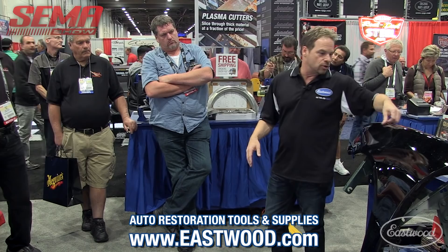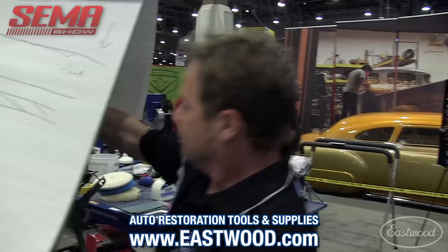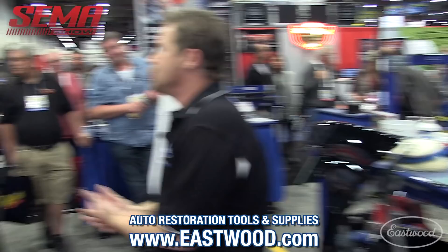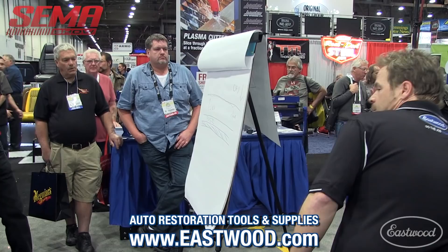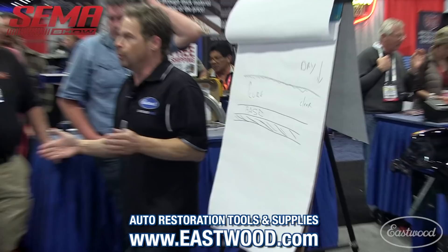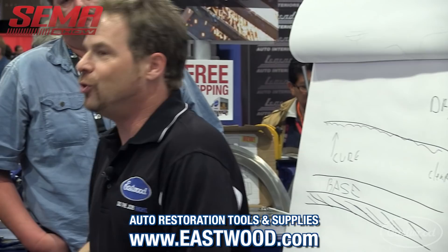We buffed this out yesterday — I dragged a run out of the fender with a razor blade and we'll talk about that. When you're planning your paint job, if you're going to buff to a mirror flat finish, you've got to have enough paint on there. According to PPG, in a two-coat clear you've got 1.5 to 2.4 mils of thickness on a dry film after two coats. With every time you sand, you're taking off four tenths of a mil — almost half a mil — every step of sanding, especially if you're doing very aggressive things.